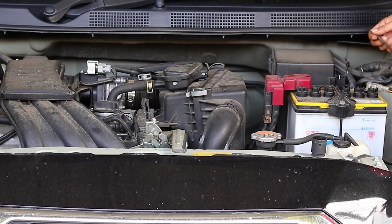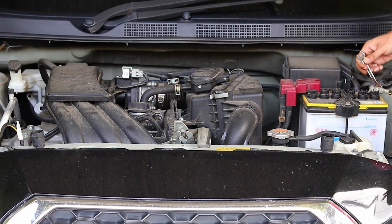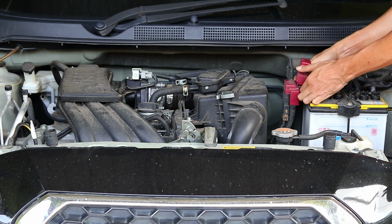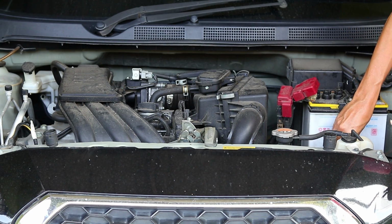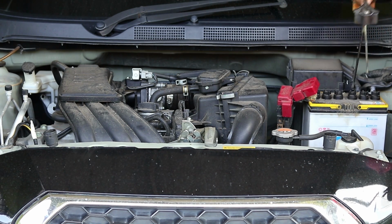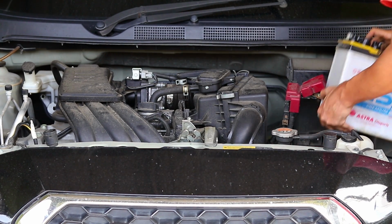Also, I forgot to mention this in my other engine videos. When removing the battery, always remove the negative first, then the positive. And when reconnecting, connect the positive first and then the negative, or you have a chance of exploding your battery, your hand and your face. And there's some cars that if you remove the battery, the time and date will reset, car seat memory and any others will reset. But it's still better than having a risk of shorting.